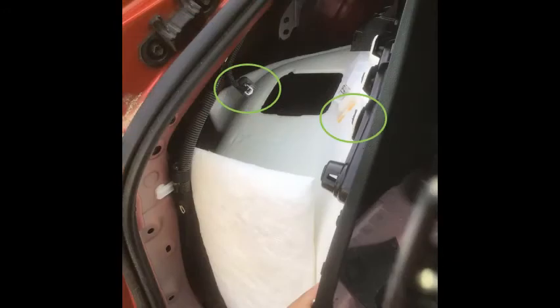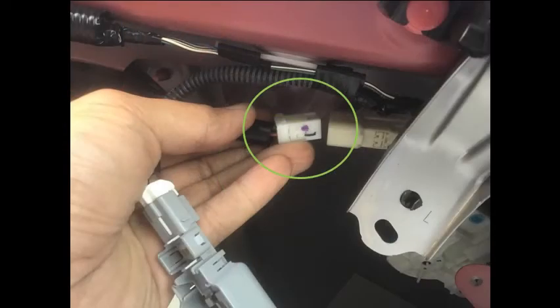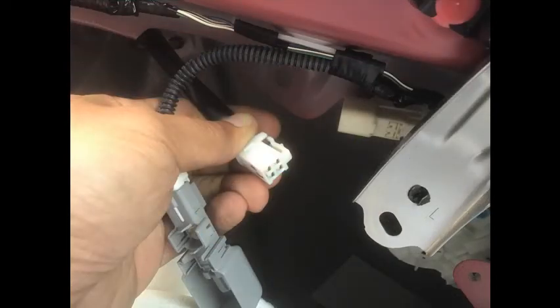With these panels, the light bulb for the rear area will have to be removed — make sure you take it out gently from the lens. Once you get in there inside that panel, you'll see the tail light plug or harness, which has the wiring you are looking for: your turn signal wire, again the green wire with the yellow stripe. Unplug it by pushing on the tab on top of the plug.